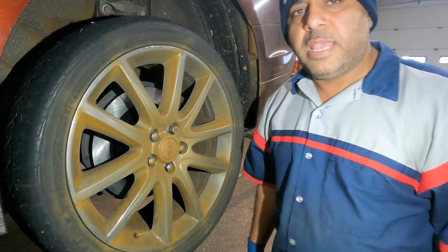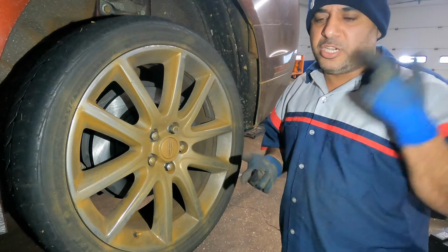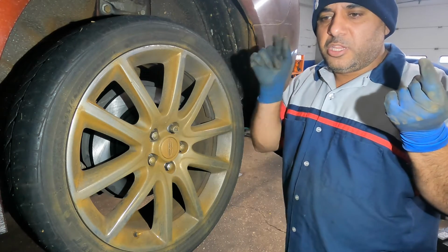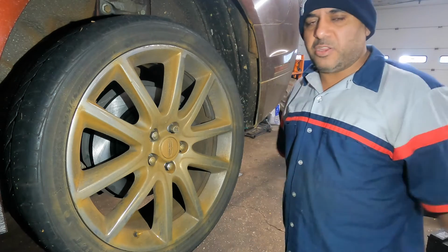And once you're done, you gotta take the vehicle off the service mode. It's a reverse procedure. You hold the button out, the parking brake, press the gas pedal, you push start, turn off, and start again. It should go back and retract back, and you're all set and good to go.